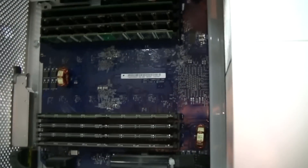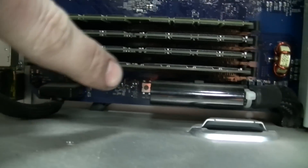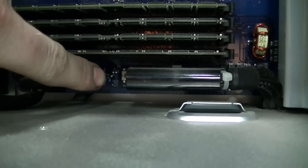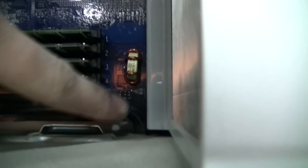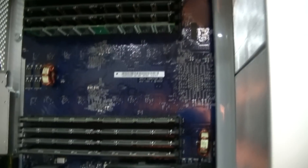I have all the RAM slots occupied — there is 4.5 gigs of RAM in here. With the fans removed, down here in the bottom of the case you can see we have a PMU reset, which stands for Power Management Unit. Sometimes if you can't get the machine to power on or stuff acts a little bit weird, you can hit that button and kind of bring it back. Make sure when you dust these out that you get in there and get the power supply — jam an air duster through the little holes and blow out the inside. People dust out the rest of the case and forget about the power supply, and then eventually that overheats and lets go and you have to replace it.